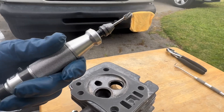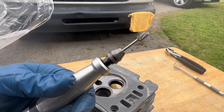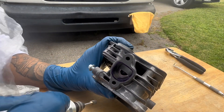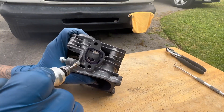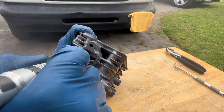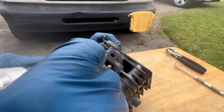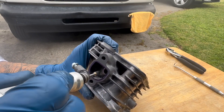Start on the lowest setting as well — that's the lowest right there, so we can go a little bit faster. Let's start right there just to get the feel for it. We're gonna go ahead and start with the sweeping motion — make sure the bit is flat. And that's what the Dykem does: it really helps show you what you're grinding off.